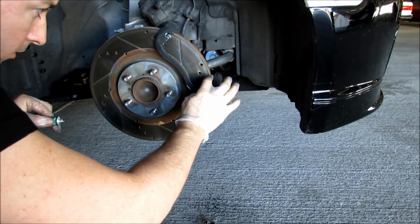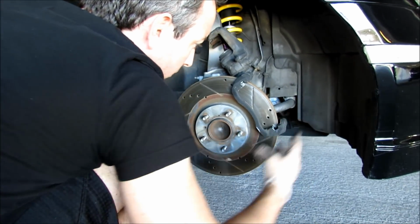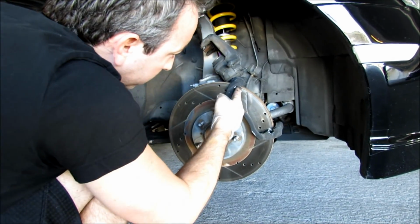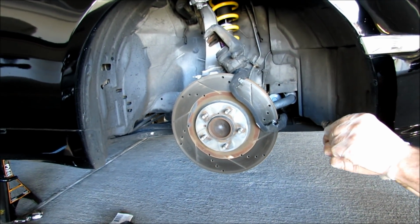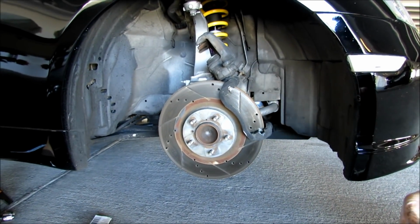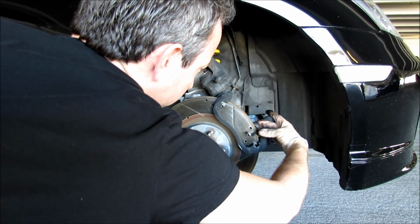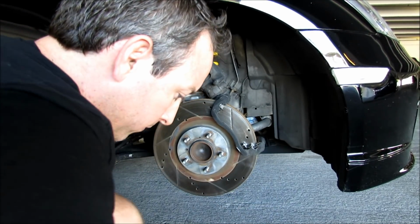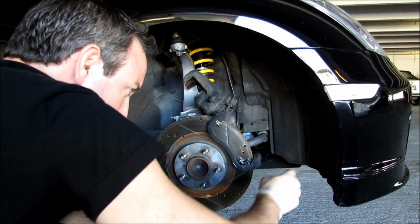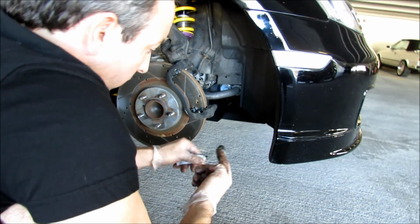This is the key to making it not squeal with the slides. Go like this, so I guess you're gonna want it on this too. Anywhere the metal touches, you're gonna want some of this goo. Beforehand, you can put some of this anti-squeal on the slides, or the metal guides, before sticking it up there, if you prefer.